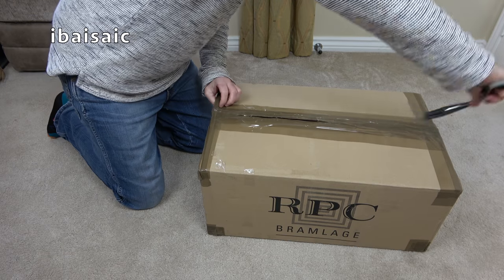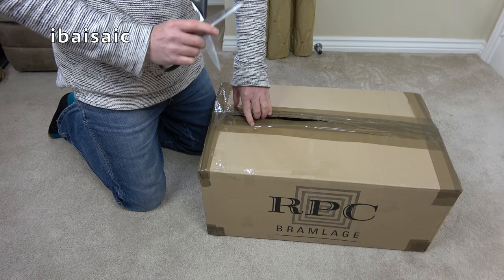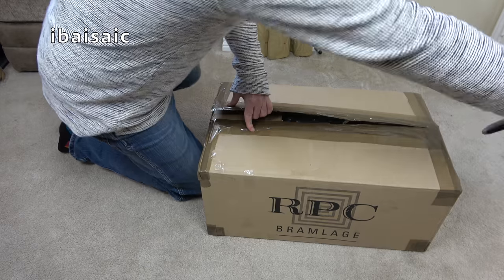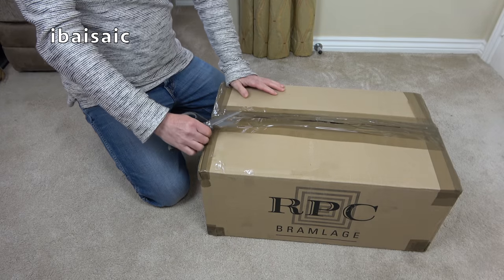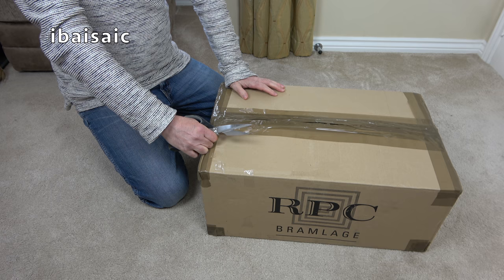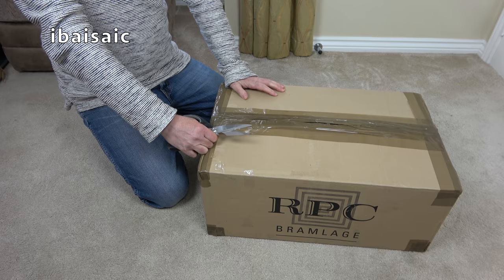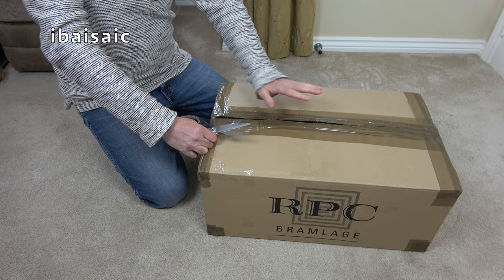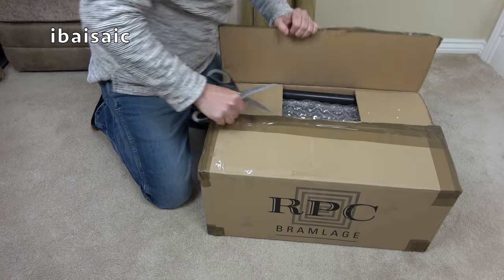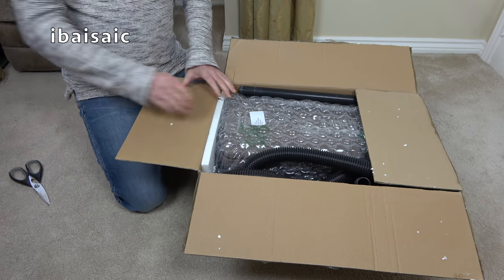Right. This is a Sensotronic System 10, so this is the Pauper's Sensotronic. Yes, if you couldn't afford the all-singing, all-dancing Hoover Total System 50, then you could get the System 10. But if you're a little bit richer, you could go at least for the System 20 that had the electronic speed control. This is just one speed, this vacuum. One single speed, and I believe a 900-watt motor.